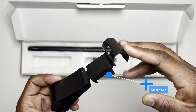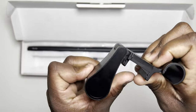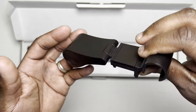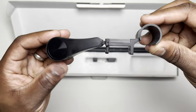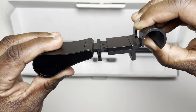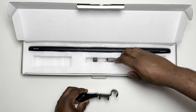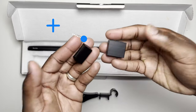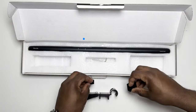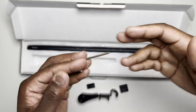The screen clip houses the lamp bar with space for the USB cable to be inserted. The counterbalance makes sure the weight of the connected lamp bar doesn't fall from the screen by providing either a firmly wedged connection or an evenly balanced pivot. The adjustable section in the middle of the screen clip is where your monitor fits in between, with a retractable spring-loaded mechanism and two included thickness adjustment covers for thinner monitors, making this compatible with monitors between 0.7 and 3.5cm thick. There's also an Allen key included for any minor adjustments.